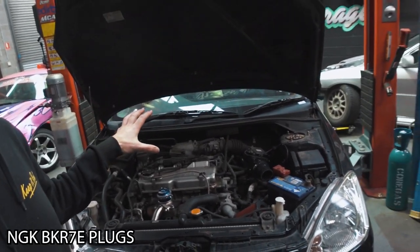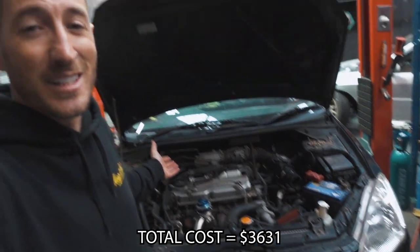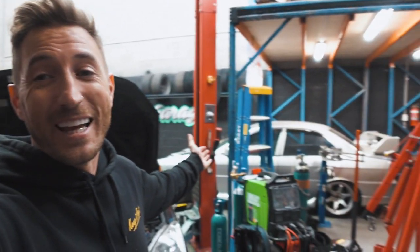Lastly, obviously do things like an oil change, especially if you haven't done one in a while. Change your spark plugs — BKR 7E spark plugs are the recommended plug if you're going to turbo your car. There you have it — that's everything you'll need to turbo your 4G93 and 4G94 motors. I hope this video has been super helpful. If you have any questions, leave them in the comments. If this was helpful, hit that subscribe button. We're doing the rear wheel drive Lancer build over here — it's a very exciting one, so join the channel and good luck on your turbo build aspirations. I'll see you guys in the next video.